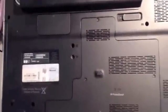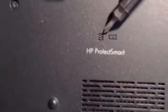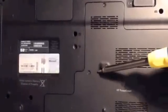First thing you want to do is take a look at the back of the laptop. Most laptops have a small symbol that looks like a little stack of CD drives — that symbol usually depicts a hard drive internal behind that panel. There are a few screws around the enclosure; we're going to unscrew this and pry off the panel. Be sure to get all the screws before you try prying it off — you don't want to damage the panel.